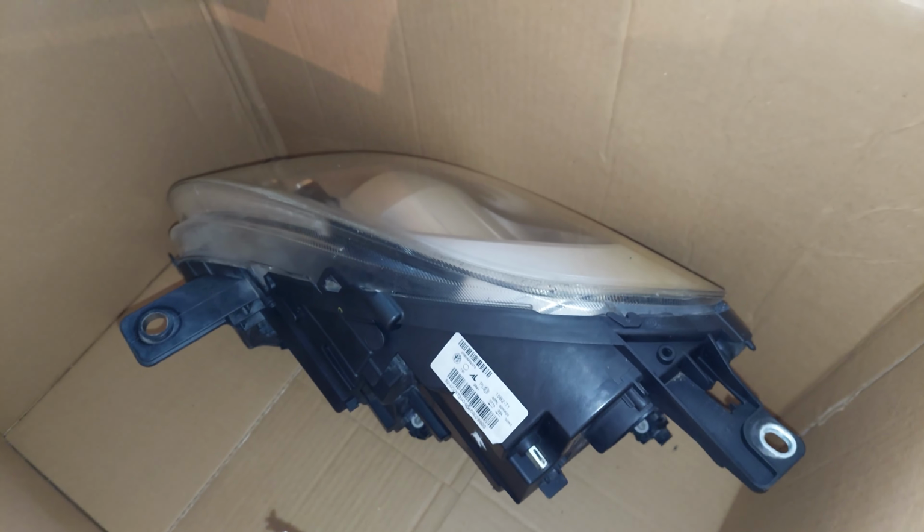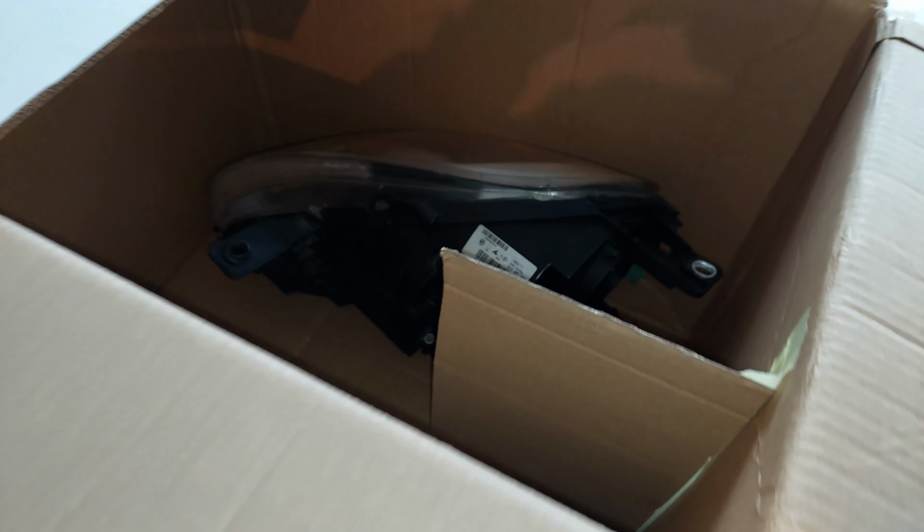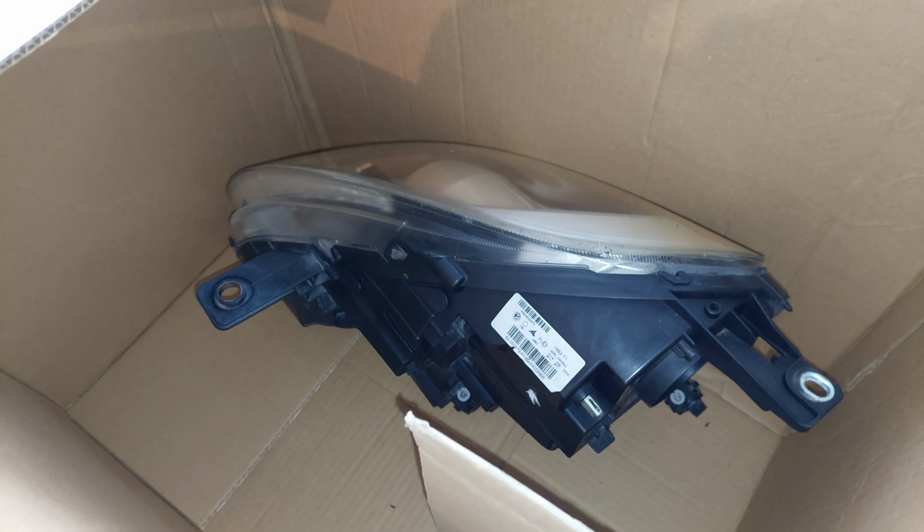Alright, so I already got my first problem. I heated the headlight inside the oven for 7 minutes at 100 degrees. Then I switched to this box because it's kind of risky to heat it up in the oven due to its size. However, I could not get the glue to get soft. So I broke off some of these bigger pieces and tested them in the oven. I heated them up to 150 degrees, then to 200 degrees, and this stuff will just not get soft.